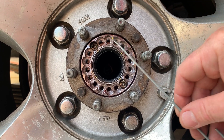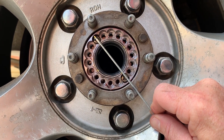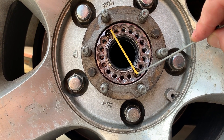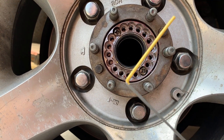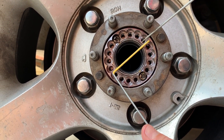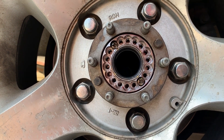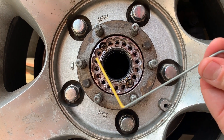We've got our set screws set in the other diagonal position that is suitable for our bearing preload, aligning with that mark there. Now, if you find that you need any further adjustments, as you can see we have the next alignment mark there. We just adjust the lower part of that hole and that hole in a clockwise direction to line up with that mark and that mark. Setting by setting, we just keep matching it from that setting across to that setting.